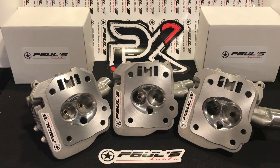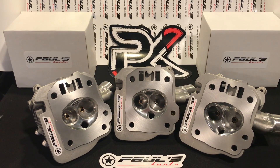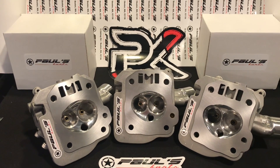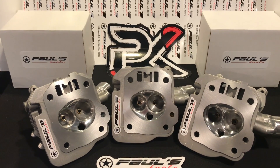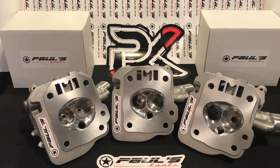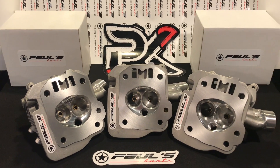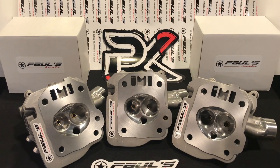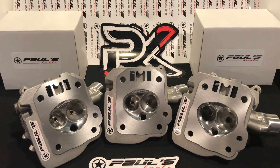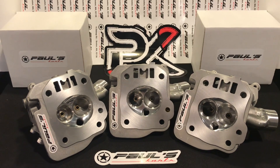The Trinity Set is the best we could find. When we did the cam testing, we ran every cam we had, took the best cam, then made three more cams based off that best cam — refining the valve timing: how many degrees after bottom dead center to open the exhaust valve, when to close the intake valve. We ran those cams, and the best cam out of all of them is the PK RPM3 camshaft.